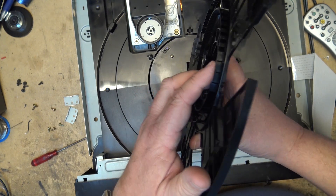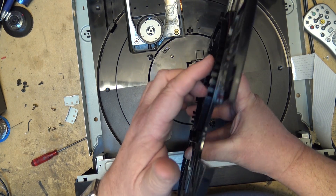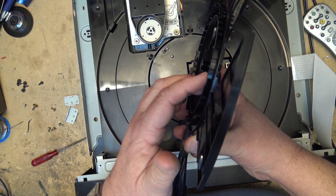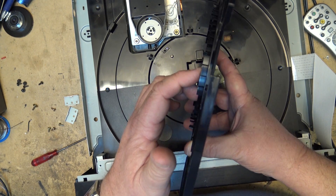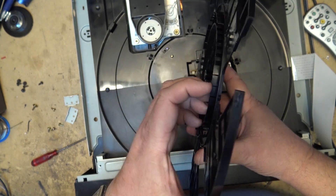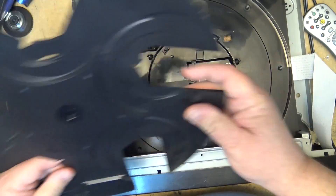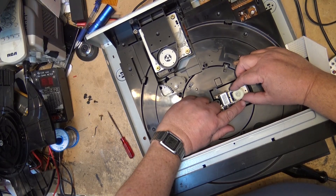When it's stopping it'll probably stop in the middle pulse. So if it counts five pulses and then one, two, three — if it gets to the third one it's gone too far, and it can back up. When it hits the center pulse it knows the disc is absolutely centered, and then it can operate the other motor to raise and lower the table assembly for disc chucking.